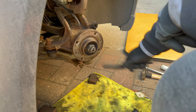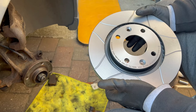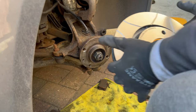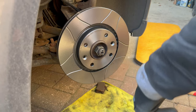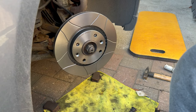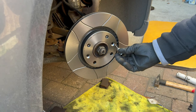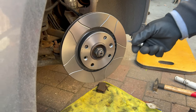It is always better to have it as clean as you can. Now you can put back your new shiny fresh brake disc — he got slotted ones for himself, so let's put it back. Put back the two new small retainer screws to hold the brake disc in place. You don't need to crazily over-tighten them — you'll thank yourself later. Align the holes and tighten down the retainer screws.